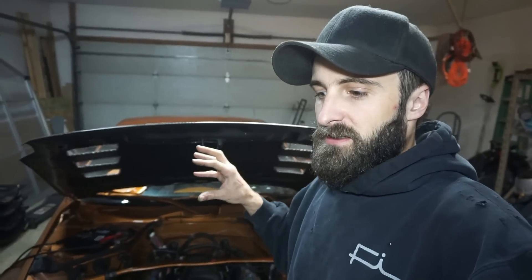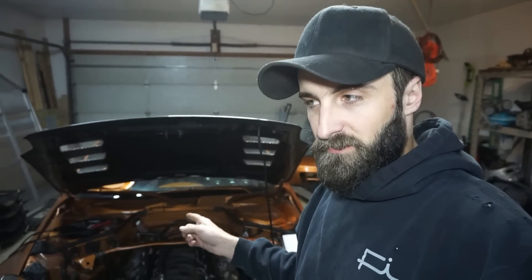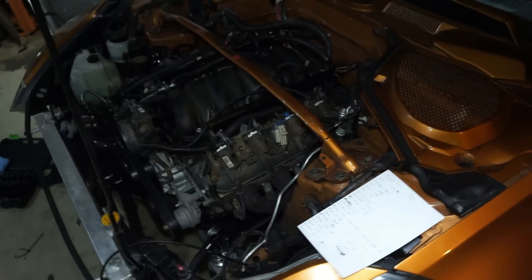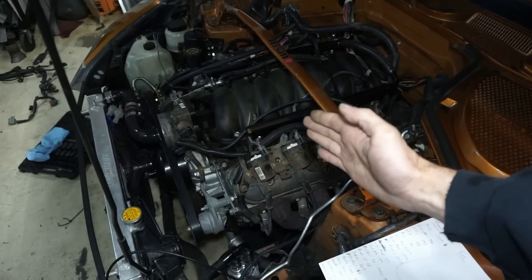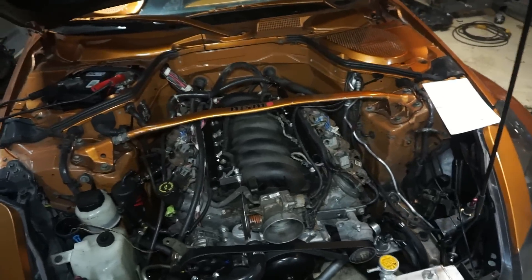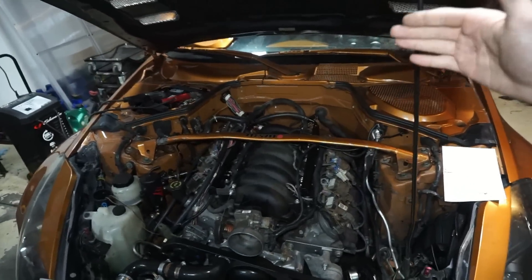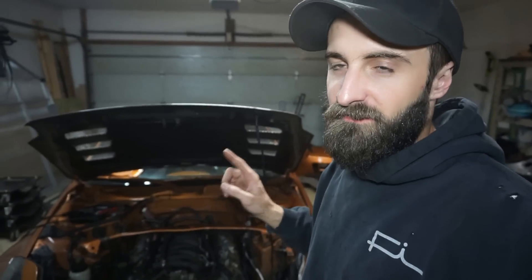The oil pan took quite a while. One challenge I accepted was that most people say you cannot or should not use the factory-length driveshaft and factory shift point with the Collins adapter, since the engine sits farther forward compared to kits like the Sikky, LOJ, or Fueled Racing kits. I decided to try to retain the factory driveshaft and factory shift point, but because of that I had to build my own oil pan — there's no off-the-shelf pan designed for this position, or at least none I found. The ones designed for this swap are $600 to $900 for the pan, pickup tube, and oil filter relocation.